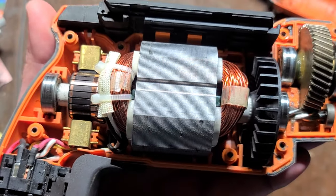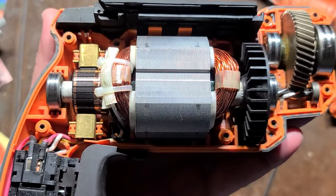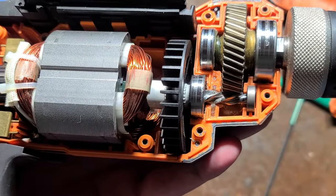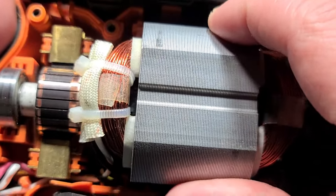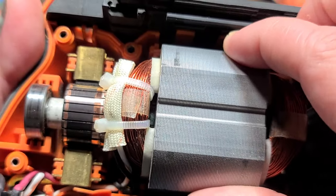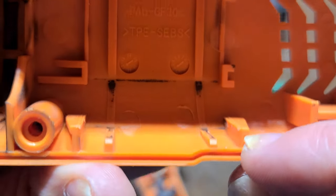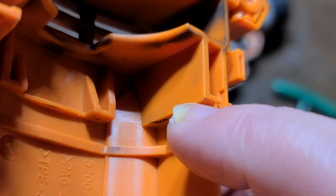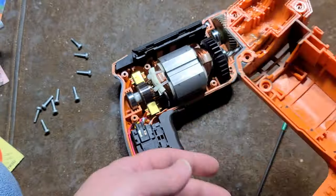There are only slight variations in how these drills are built — there's only so many ways you can build a 3/8-inch general purpose drill with variable speed trigger, motor, ball bearings, and helical cut gears in the front. That rattle is because the field just isn't held very tight and can rock back and forth. They could have done a better job staking it, because all that's pressing down is these really thin fingers. Some manufacturers put in several fingers or make them really wide, but when they're this thin it doesn't take much for the plastic to get just a little bit worn and flattened, and then you have a field that rattles and makes funky noises.